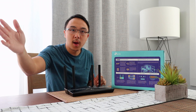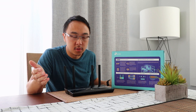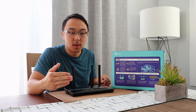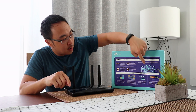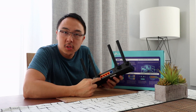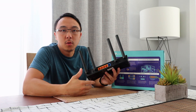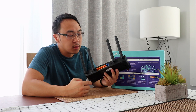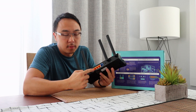What does that mean? If you're far away and the 5 GHz signal strength is, say, 20%, it's obviously not going to use that. Instead, it's going to use the 2.4 GHz, which has a stronger signal. If you have the same SSID set for both, you can take advantage of that smart connect. It also has gigabit internet access — these orange ports essentially provide the best speed for your device. If you're a gamer and you want super fast download and lower latency, you can just plug your ethernet cord into the back of these ports.